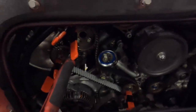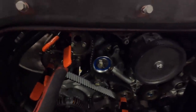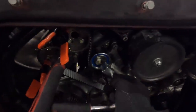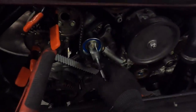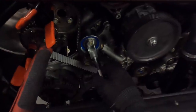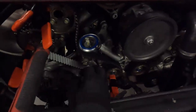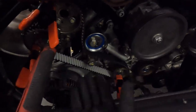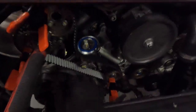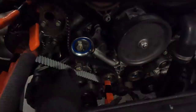Okay, so this next bit is the tricky bit. We've got three things that we need to do here. So first of all, we need to tension our bearing. So we use our little tension tool here. So we move the bearing, that tensions the belt. So we take a reading from our belt. That is a frequency reading, which I'm going to do on my phone. We need to make sure the frequency, that is the most important, of our belt tension is correct.